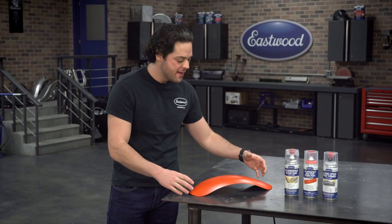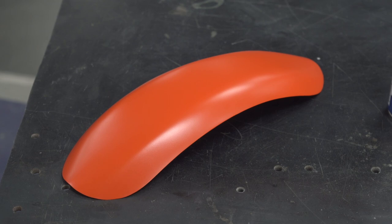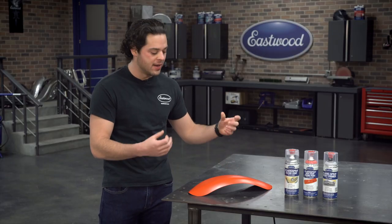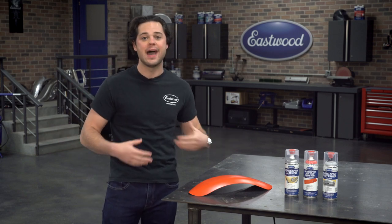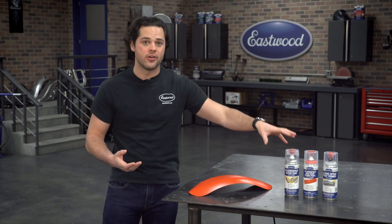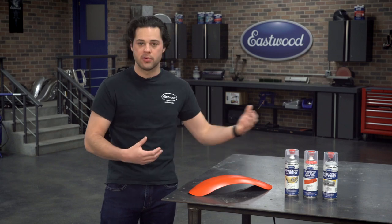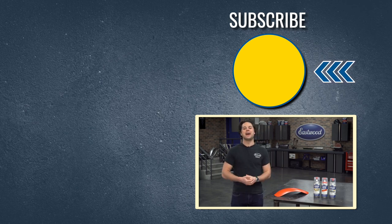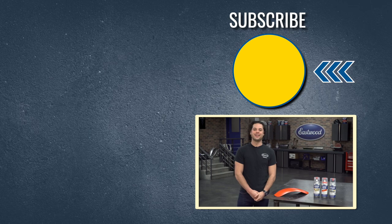After a weekend of drying time, I am super stoked with how this turned out. We went with that Chevy Orange high-temp engine paint for a little bit of pop, and a matte clear over top — nice even reflection. I think for what I put into this, it looks super good. Now if you were going to do it with a paint gun, all the steps would be the same exact thing. However, it just goes to show you how easy the 2K aero sprays are to use — there's no cleanup, you spray right on, and you can get something that looks just as good as if it was sprayed out of a paint gun. Subscribe to the channel — we're giving away a MIG 180 welder at 500,000 subscribers. As always, thank you for watching. I'm JD — make sure you keep it right here at Eastwood to do the job right.